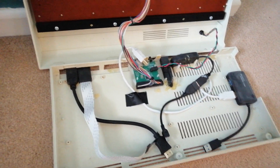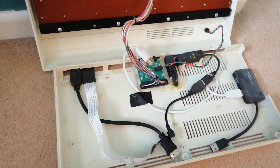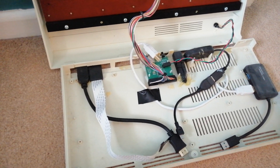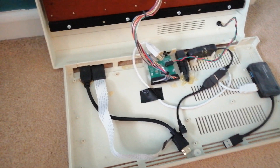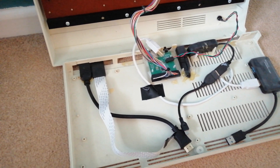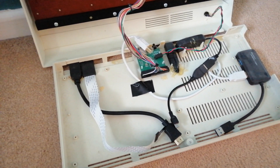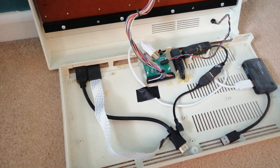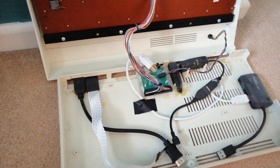For Commodore machines, you can combine it with an OS called Combian — C-O-M-B-I-A-N — and there's a Facebook group dedicated to that. It makes the Pi boot up straight into Commodore's BASIC OS, whether it's Commodore 64, Plus 4, VIC-20, or PET, with no startup text like a typical Linux distribution — it boots in about half a second. You'd never know it's not the real thing. I just like Raspberry Pis and retro computers, so it's a good halfway meeting point of hobbies.